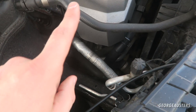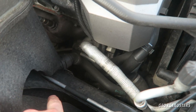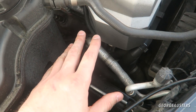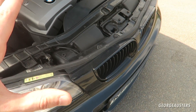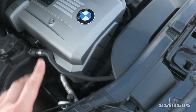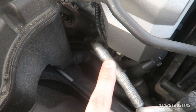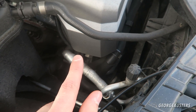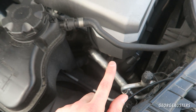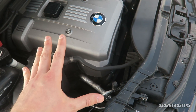The next part common to fail at 100,000 miles is the thermostat, which is bolted on to the water pump in the same area. When replacing either one it makes sense to replace the other as well, because access is not great on this 130i — the best method is actually to remove the front bumper. It's not belt-driven and access really isn't great, so if your car has reached 100,000 miles and either one has not been replaced, go ahead and replace them both.